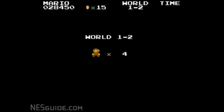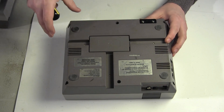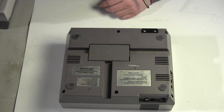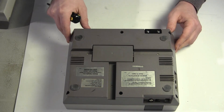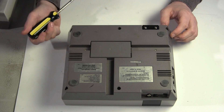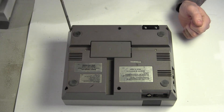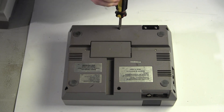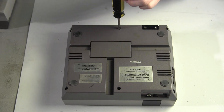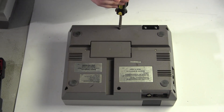So I'll get a console in front of us, we'll get it turned upside down, and we'll get it ready for disassembly. Also, it's a good idea to keep a spare cup to keep screws in — I've lost them before, not a good thing. This is pretty basic — you have a couple screws on the bottom you're going to want to take off. There's three on the front and three on the back side, and it's just a regular Phillips. You've got your 1, 2, 3, 4, 5, and 6. Sometimes they stay stuck in there — this is where a magnetic screwdriver can come in handy. But if you're careful, you can just turn the console over and scoop the screws up, put them in a little cup or whatever you have to hold them.